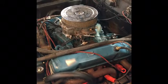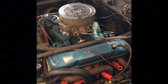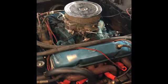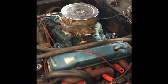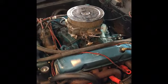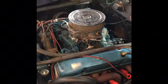We just got done running it. I let it sit all morning — about four or five hours — to let everything set up, then fired it up and ran it about 20 minutes. Both of the oil leaks are not leaking anymore. They're fixed. For those of you struggling with getting these sealed up, the Hi-Tac does seem to work.